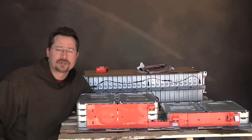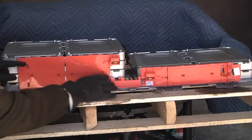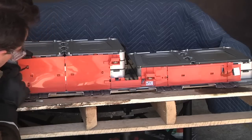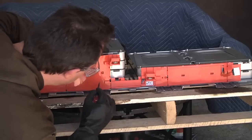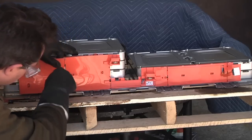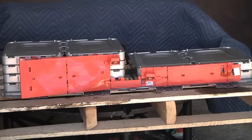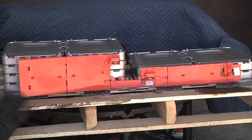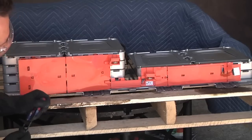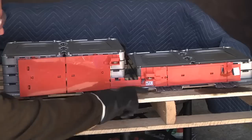The main thing to start with is that the terminal ends of all these cell modules are covered with orange plastic that wraps around the bus bars, the BMS wires, and the battery terminals. It basically all just snaps together, so what we have to do is unsnap all these different little connections. They pry up pretty easily for the most part with a little screwdriver, but some are a little hard to get at. Keep in mind that here and here are the exposed high voltage terminals — somewhere between 96 and 100 volts — so those are the things we don't want to short.